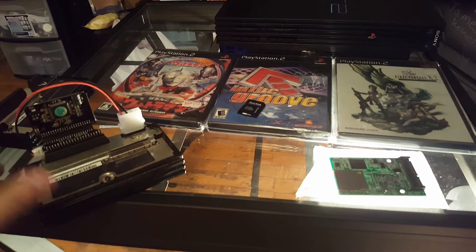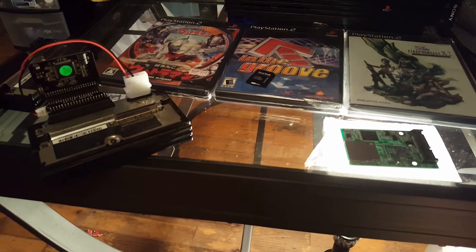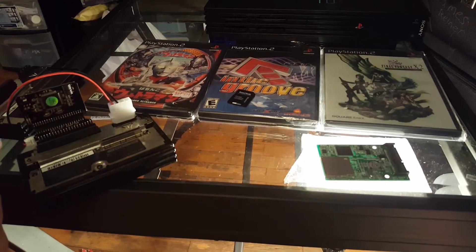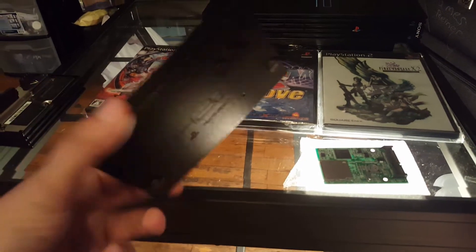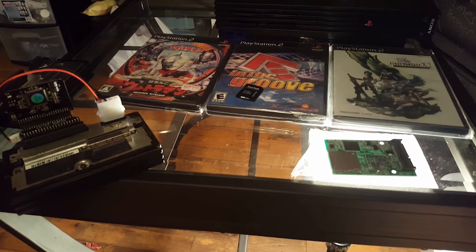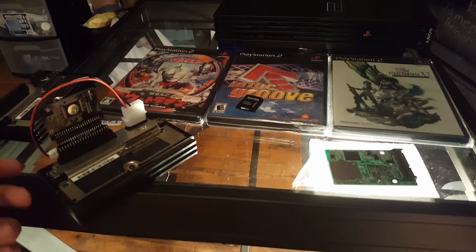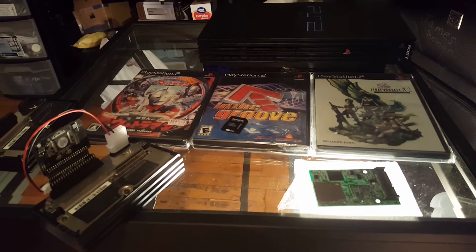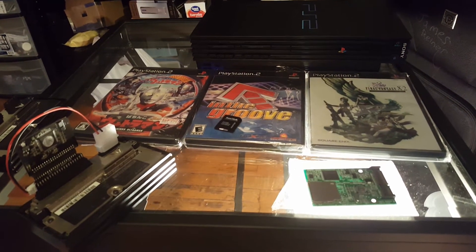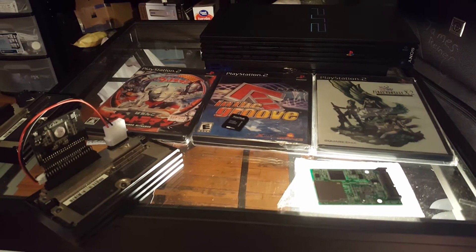That's pretty much the full setup and it's really easy to do. For the software side, you need a copy of WinHiip for Windows — I'll put a link in the description along with the tools — and you use that to format the SD card just like a hard drive, then pop it into the PS2. Obviously you'll also need a way to boot into a hard drive loading homebrew like HD Loader or Open PS2 Loader. Personally I just have a memory card modified with FreeMCBoot, and if you're interested in FreeMCBoot there's a link for that.